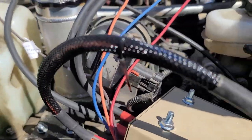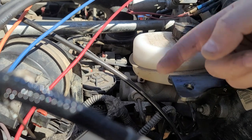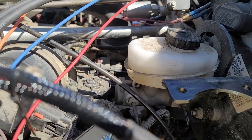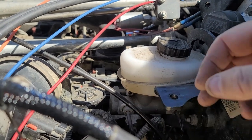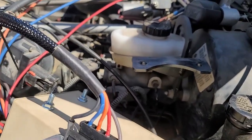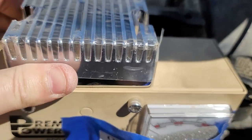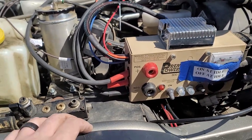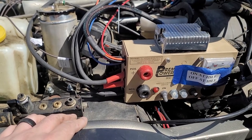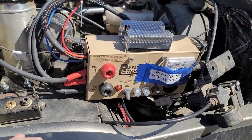I'm going to have the bracket mount off of here, L down. I'll use this little gap here to put a small gusset, probably put another one — the top piece will angle in. Two gussets: angle, flat across, flat down. I'm going to work with whatever steel plate I have that's less than a quarter inch thick. It needs enough strength to support the weight of this thing while driving around and also when running 25-foot welding leads off of it, so it'll have to be slightly beefy but it doesn't have to be a tank.